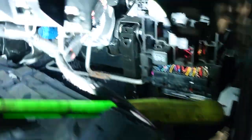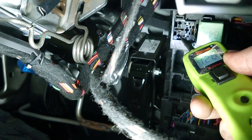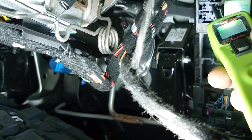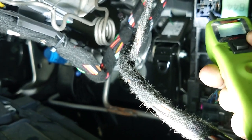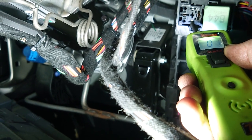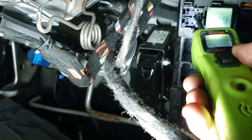Ignition is on. So what have we got here? We've got 12 volts on that terminal. Should have nothing on the terminal opposite. Terminal two — our ground is the top, and that definitely shows as a ground. There's not a lot going on this bottom one, certainly not 12 volts with the ignition on. So what we can do is jump that across to there and see if that works.